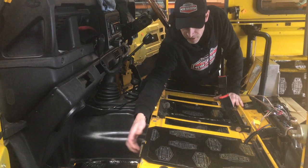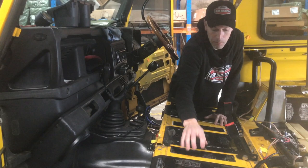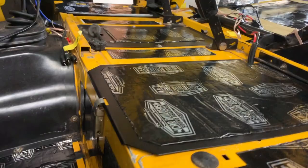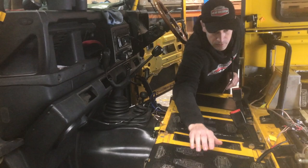So you'll do that tile layout first like we've done here. We've cut everything to size, doubled it up, and applied those pieces so you can see where we're going to put them. Don't be concerned that you've got to cover 100% of all this. We've got a product - our mass-loaded vinyl - that we're going to put as a blanket over this as a sound barrier. It's going to stop noise coming up. So this is purely dampening - it's going to take out the panel resonance. As you can see, it's done that - as opposed to over here where you tap on it, it's a lot more solid.